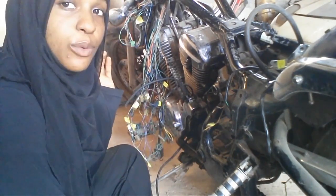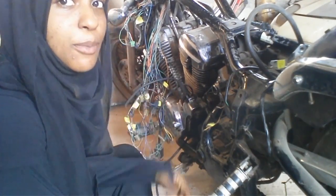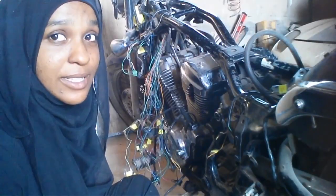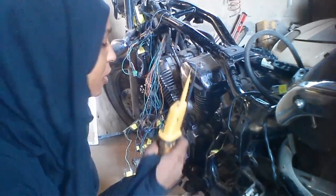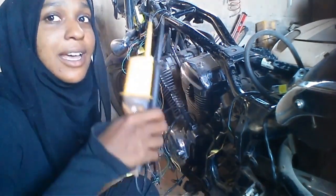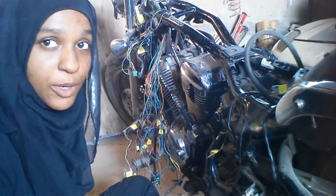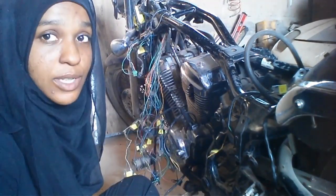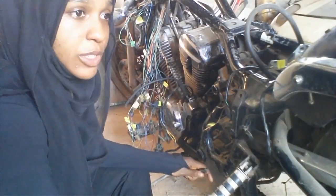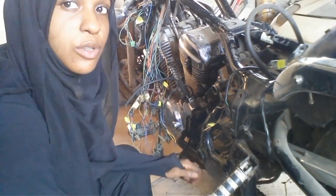And if they happen to accidentally then put the bike into gear whilst you're not there, you wouldn't know. Now if you're not expecting it and you've disabled your neutral switch, if you then start the bike, it will start and drive off. Or if you yourself have accidentally put it into gear without realising, the bike won't start unless it's in neutral. Because then even when we do wire in a remote start, which I think my dad probably will do because all his bikes are remote start.